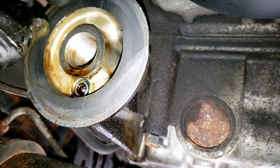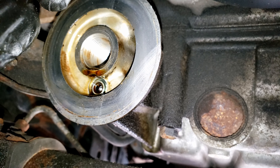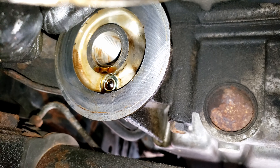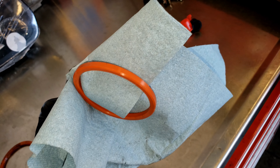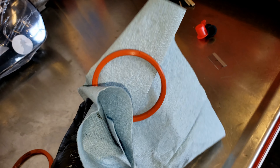In fact, it's really a better idea to spray this down with acetone and use a brush to clean it all before you even take the oil filter off to begin with. Also, after you wipe down the mating surface, if you see any corrosion, make sure to use a Brillo pad and clean that up. I also recommend rubbing some grease on this surface.